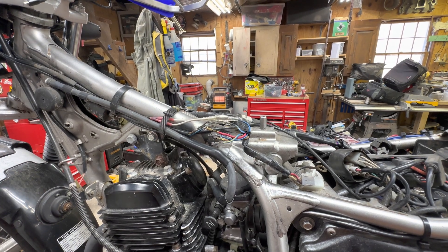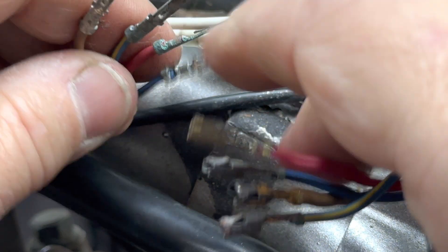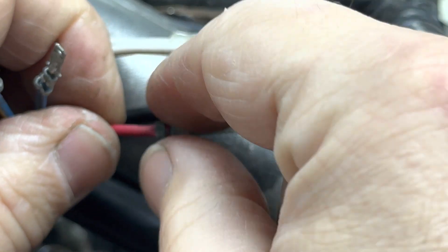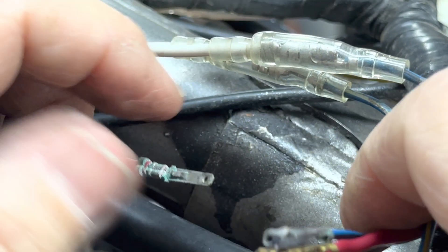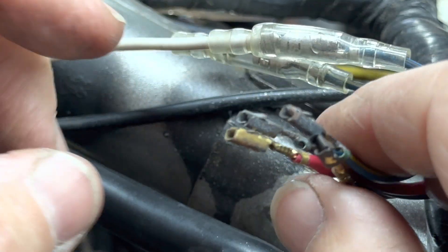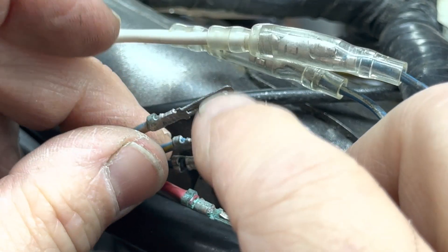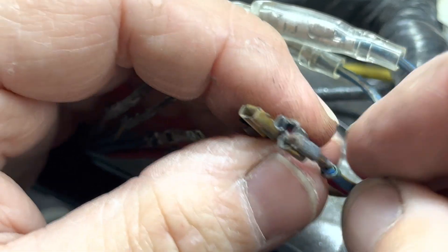So here's what I'm seeing. Take a look at this connector — it's got some nice corrosion in here from moisture and electricity together. This one definitely could be cleaned, but it definitely has some corrosion on it. What ultimately ends up happening is these connectors fail. These are all good for right now, but this side is not.